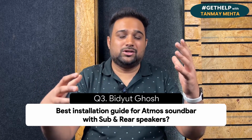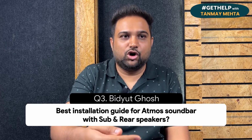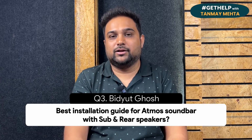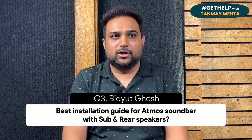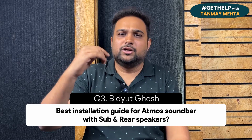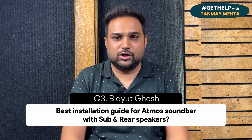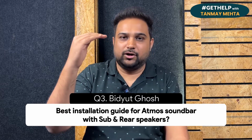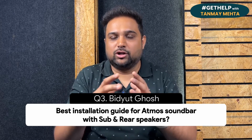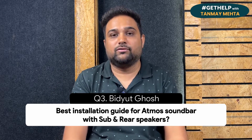Now overall, for these kind of soundbars to really work into a room and give you that surround sound experience, you definitely cannot go beyond 13 to 14 feet in terms of the viewing distance, because more is the viewing distance, narrow is going to be the angle of your front left and the front right speaker. So try to be as close as possible. There are some soundbars which have got directionalized throws wherein you would have a sound reflecting from the ceiling. So in that case, if your room height is double, for instance if it's a 15 or a 20 feet double height ceiling, then that will not work for your Atmos soundbars. So you would need a room which has got a maximum ceiling height of 9-10 feet and you need to be at a distance of somewhere around 13 feet or lesser than that. If you can manage all these things, then definitely a Dolby Atmos soundbar with the surrounds and a separate subwoofer can be a nice system to have with your TV or even with a projector screen.